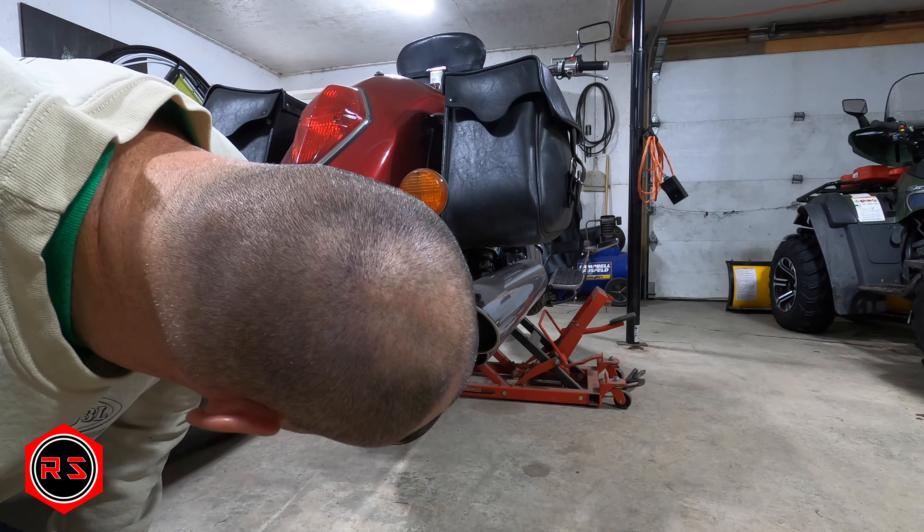I'm using Rust-Oleum high-temperature paint for barbecues — it should be good enough for my purposes. There you go — it's painted and now pretty much dry. Obviously the holes are still showing, so any cop that looks closely will see them and know it's not normal, but it's more subtle than completely removing the baffle and having a large hole at the end of the muffler. I'm pretty happy with the sound so far. I'll know more in spring when I start driving, but I'm confident it will be loud enough.